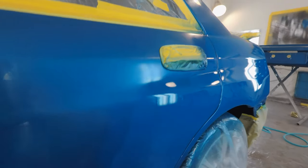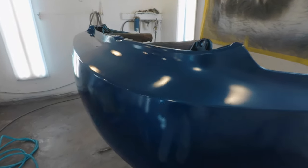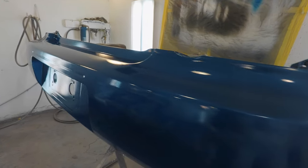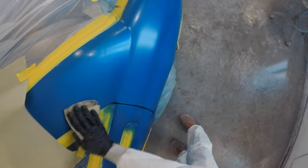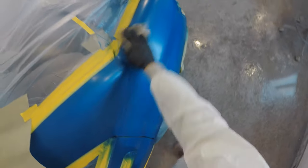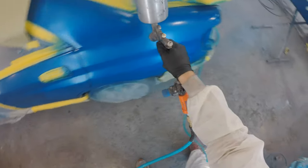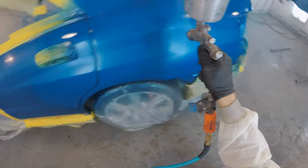As you can see, the first coat comes on really transparent. You don't want to spray it on nice and heavy and have it run, so it takes a few coats to cover it. When it flash dries, I grab a tack cloth as usual, tack down the surface removing all kinds of debris, dust, and particles from the air that may contaminate the surface. Then go over with another few coats and just kind of blend it — that's pretty much how any car is painted really.